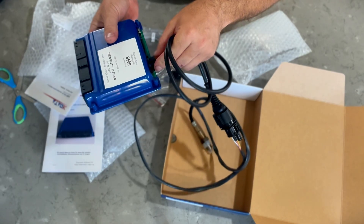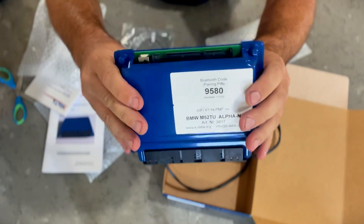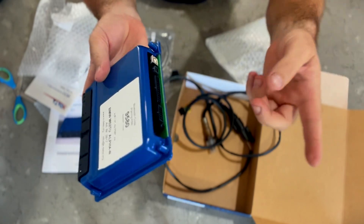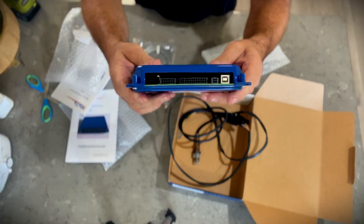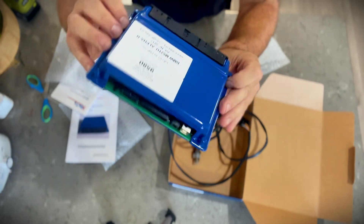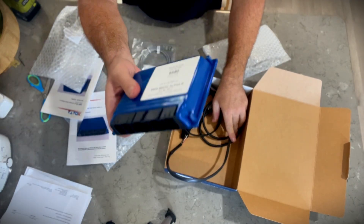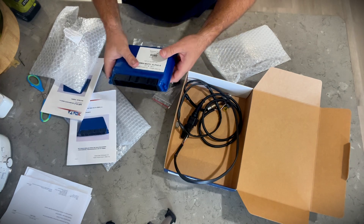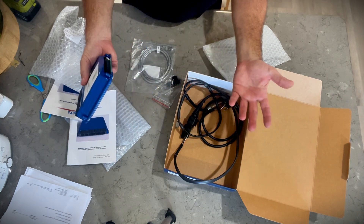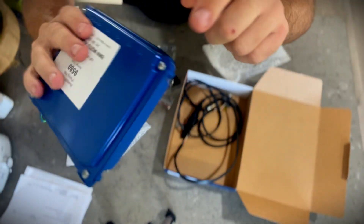That's your O2 sensor, and right next to it there's a little pipe — that's the onboard MAP sensor. What's awesome is if you want to go turbo in the future, you can ditch the airflow sensor and go MAP sensor straight into the ECU, with the wideband — everything you need for engine management. You can get these in Bluetooth and non-Bluetooth versions. I got the Bluetooth version, which was around $760 AUD. All the cables and everything came to about $140, and shipping from Germany was about $60, so landed in Australia it was around a thousand bucks total — and it only took two weeks. The case looks plastic but it's actually all metal.